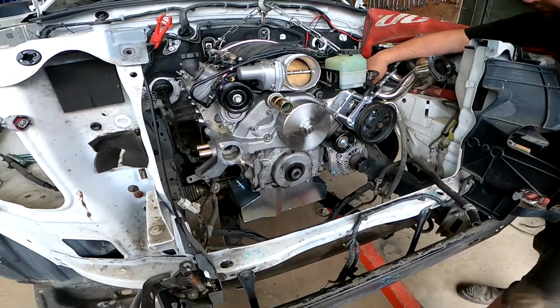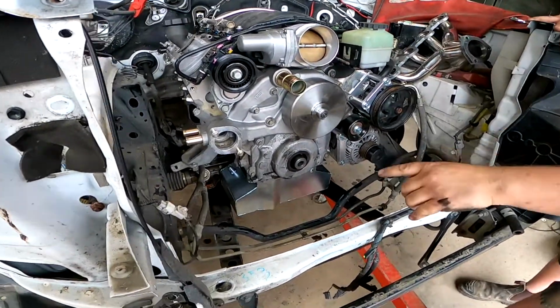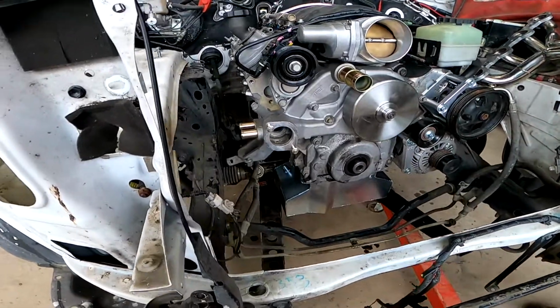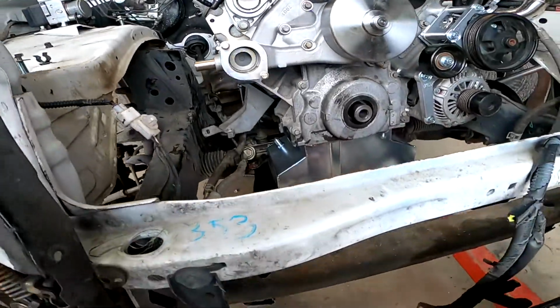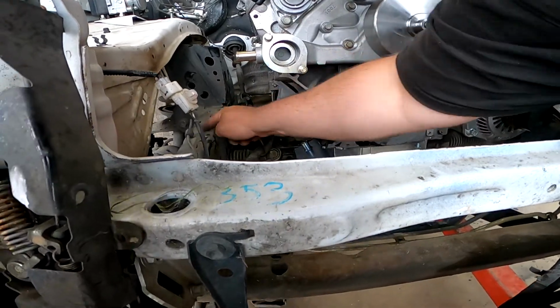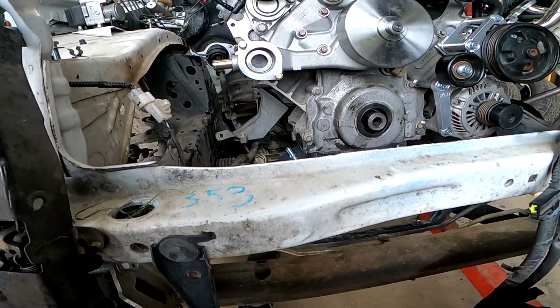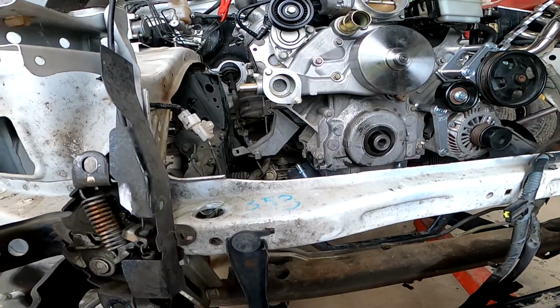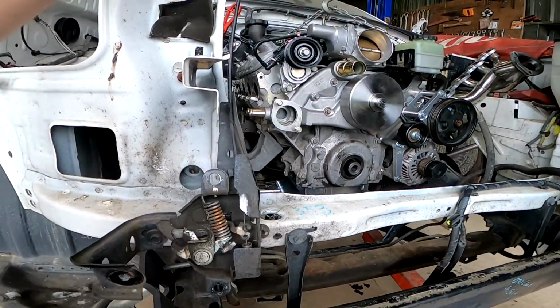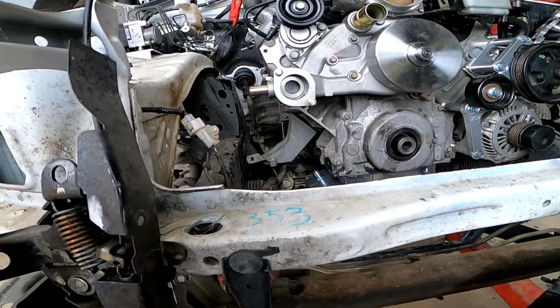We'll get an engine mount bracket to slip in there, eh? So the power steering's going to be a bit of an issue with the engine mount. But I figure we can just flick that up, that hollows all up and around, like we did on the other one. Come around, both of them. Maybe we just swap that mount out because you've got fouling on that AC bracket anyway. Maybe we just build mounts that come straight out and sit on the top of the chassis.